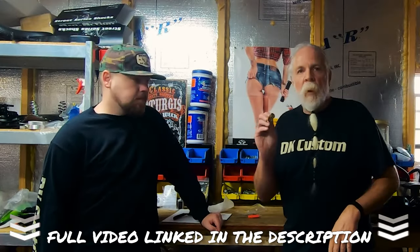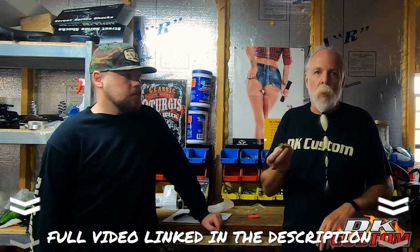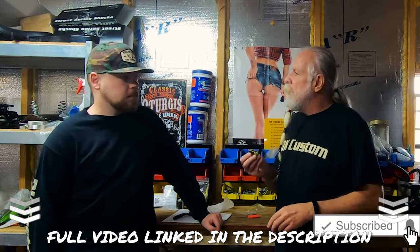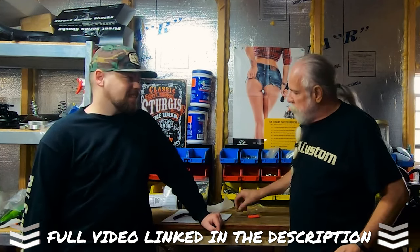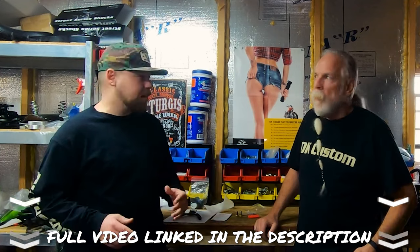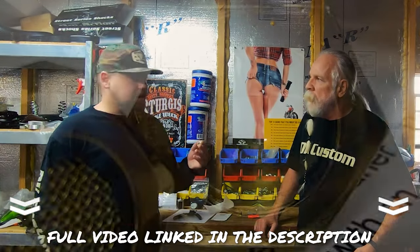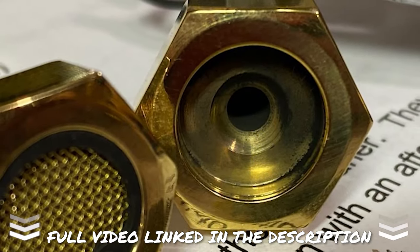We've had a lot of people ask about how the Outlaw Breather Bolts work and what bikes they're for. So why don't we address what bikes run good with these and what maybe you want to stay away from. Well, we classify bikes in a crude manner — your bike's either a spitter or it's not. And if it's a spitter, these bolts can be messy because there's really nowhere for that oil carryover to go other than along the side of your bike.